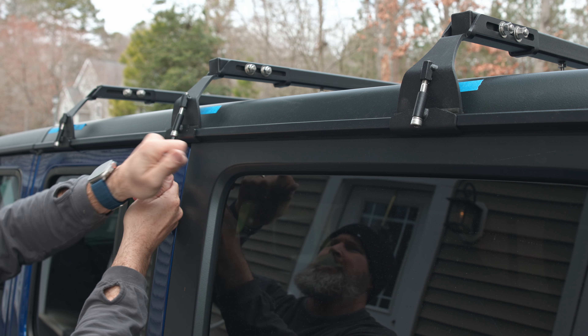Before tightening this down too much, I just want to make sure the bolt is in line with the mark. With the carriage bolts just hand-tight and the Allen wrench to tighten a decent amount, here's how you know if you got it right: if correct, the framing of the actual rack — where it comes down — will be just on the inside of the outside edge of the hardtop gutter. That's what allows the rubber gasket to pinch toward the other rubber gasket and create that nice tight connection.